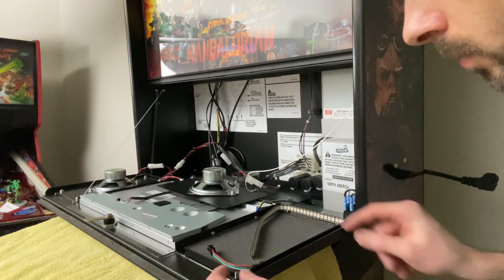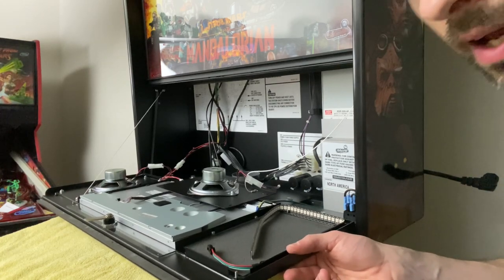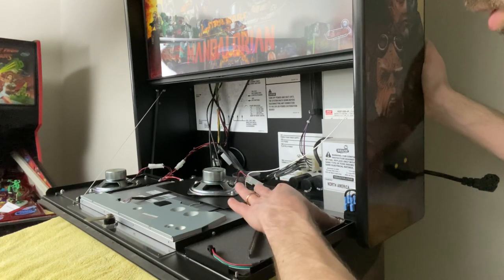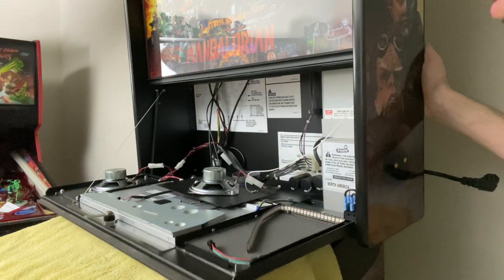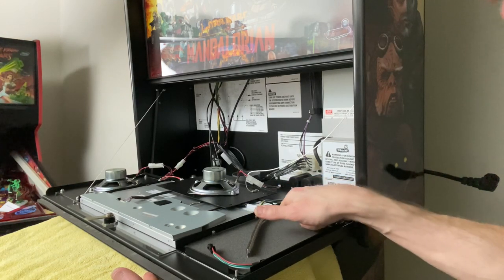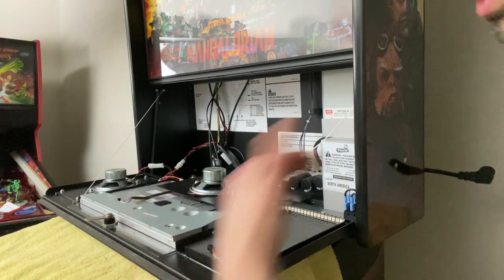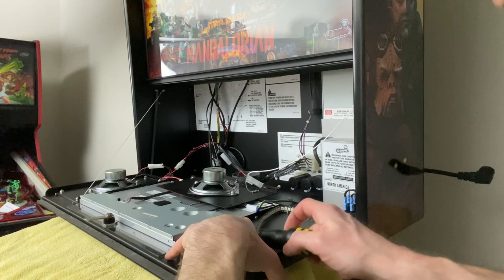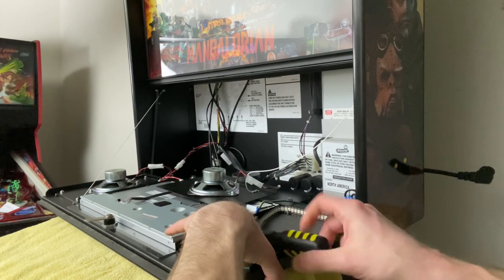There's a little bit of give as you slide the frame up and down — there's a hinge here, and these two bolts are what mount the whole grill frame to the hinge. Before you tighten these two bolts down, push forward toward the back box while you tighten them, otherwise you're not going to be able to close the grill afterwards. Just rest your hand there while tightening — the grill is going to want to creep up. Just prevent that from happening; you don't need a lot of pressure.